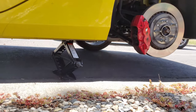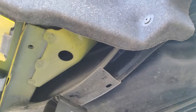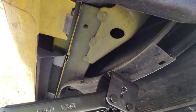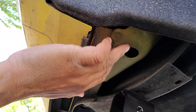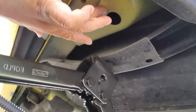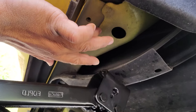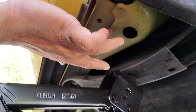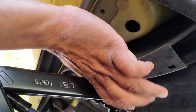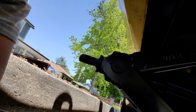There's the jack. Again, this brace right here — very simple. You don't want to jack on the body, you're going to bend some stuff. I've heard this car called a unibody, which means it doesn't really have a frame. So what I could do is find a frame-like member, which was this. Put it there — and boy, was this hard to crank up.